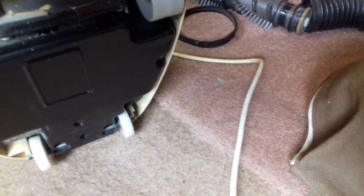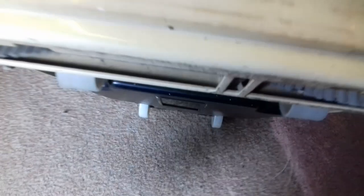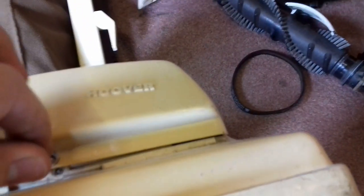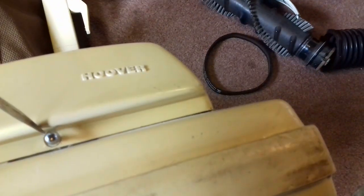It's not got the wee sticker on there, and it has got a pin for the handle. Brushes are grey on this one and the brush was in better condition. Early nozzle plate in almond, and this one is 1982, which is quite early. Here's the belt cover — that belt is quite worn but it should be okay. The cover isn't in as good condition as the other one and the wee clip is missing. The screw for this one is quite worn so we used a flat blade to take it off, which is a useful tip.